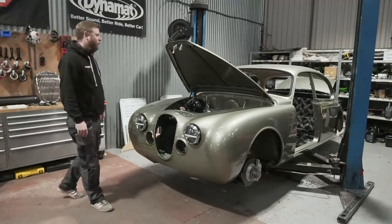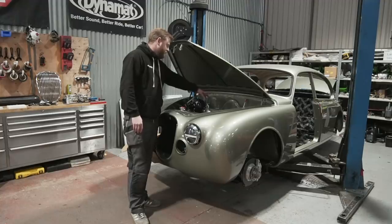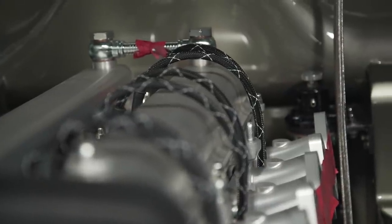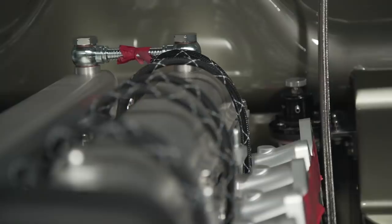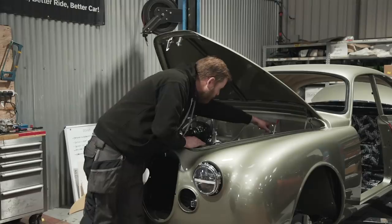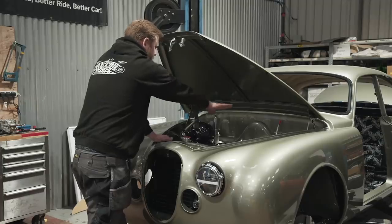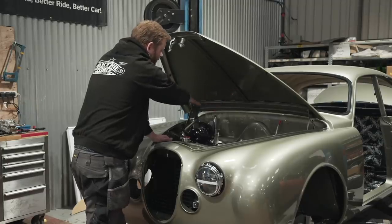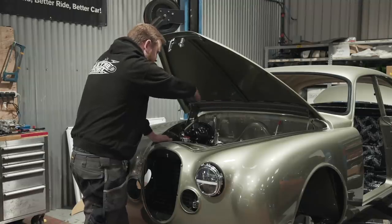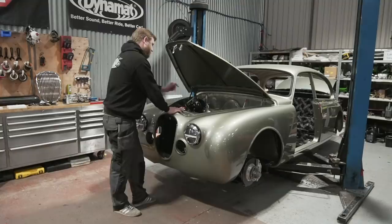The only remaining thing was the breathers. We've done these banjo breathers on the back of the cam covers - quite a nice vintage way of doing it. We could have used threaded air-equipment type fittings but felt they would look too bulky. We haven't yet fabricated the breather tank that sits up here because we wanted the engine in first so we could work out exactly the sweep of the pipes running from those breathers to the tank, and put the spigots on at exactly the right angle for a neat gentle sweep.